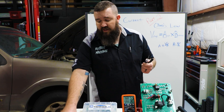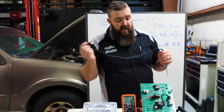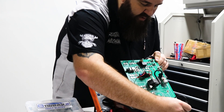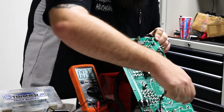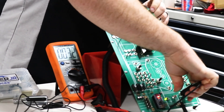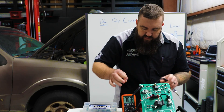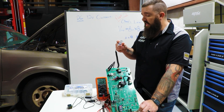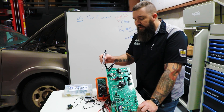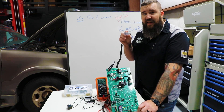We've got two different test lights here from SP Tools. The first one we're going to use today is the LED test light for the diagnostic unit, and we're going to hook this one up to our ground on the battery portion of our e-trainer test board. Now for using these test lights, how they actually work is kind of like your meter except instead of reading numbers on the screen, it's just going to have a little LED light built into it.